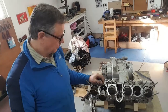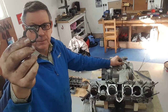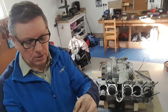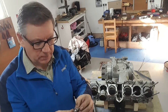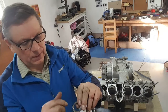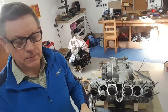I've been a little while. This nut for the clutch had basically been put back on with a chisel, and it had been put on so hard that it had actually distorted the thread. That caused me two problems: I couldn't get the spanner on there to undo it, and when I tried to do it with a chisel it was tight. In the end I had to get a Dremel and actually split the nut to give me some latitude to get it off. That's been a bit of a mission.